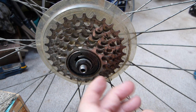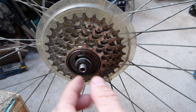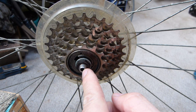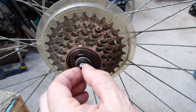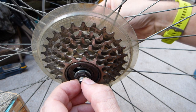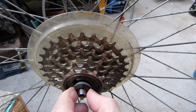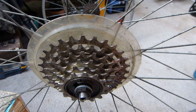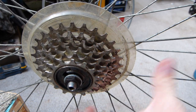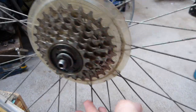They are fairly straightforward to work with, but they are a bit of a tedium. In this video I'm going to show you how to adjust after this axle has been maintained, rebuilt, or lubricated — whichever the case might be. I'll show you how it's adjusted so that it's not wobbly side to side, and neither too tight or binding. I have a greasy component here which is difficult to observe, and another bicycle wheel with the same cup and cone style hub with dry components, so I'm going to contrast the two of them.